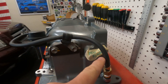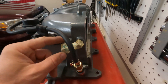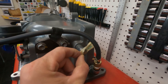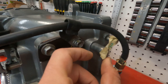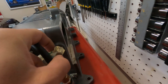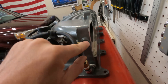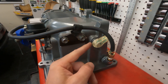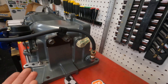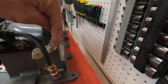You can run your PCV and evap lines here. You're going to need appropriately sized lines — this one is about a half inch and the other is probably three eighths. You'll likely need to make a couple of trips to the automotive store to get the right sizes. At the time of filming I don't know yet exactly how much line I'll need.